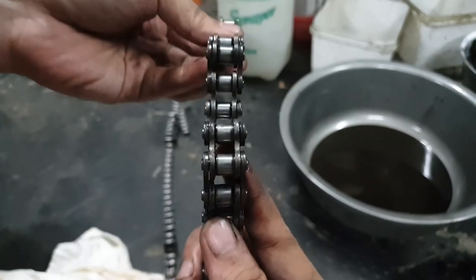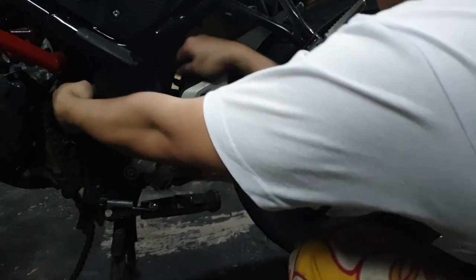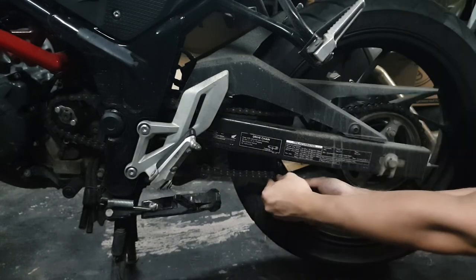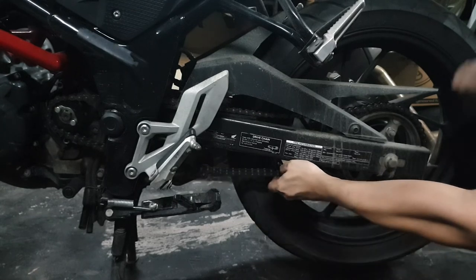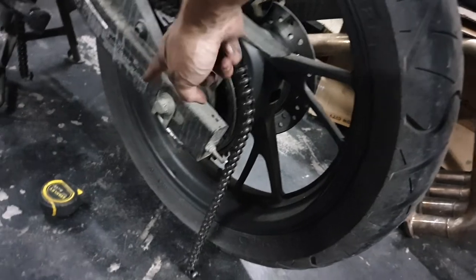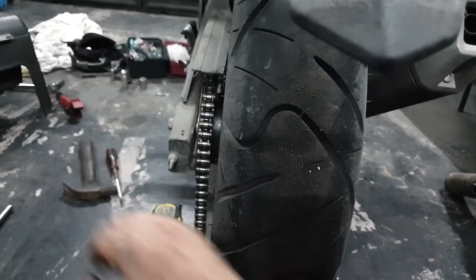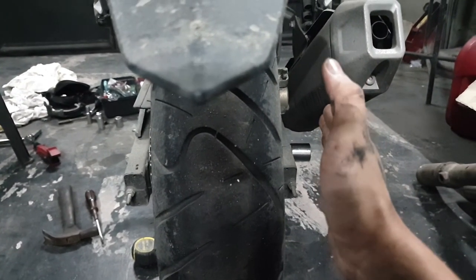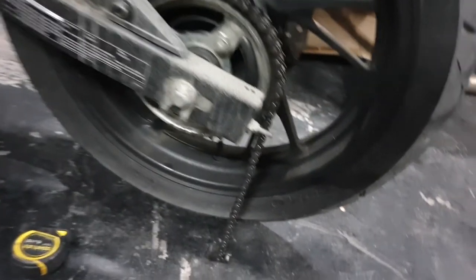The chain is squeaky clean. Now let's put the chain back on. As expected, since we changed to a larger sprocket, the chain won't meet anymore — that means we need to adjust the rear hub to go forward. Here's the gist of what we're gonna do: first we're gonna loosen the axle — there's a 17mm — then we're gonna adjust the chain adjusters on either side so we can move the tire forward. It's crucial that you turn these the same amount so that the tire will remain straight.